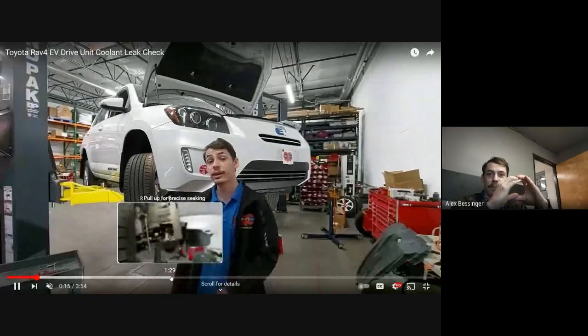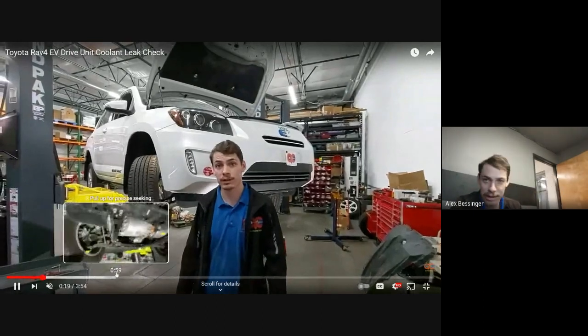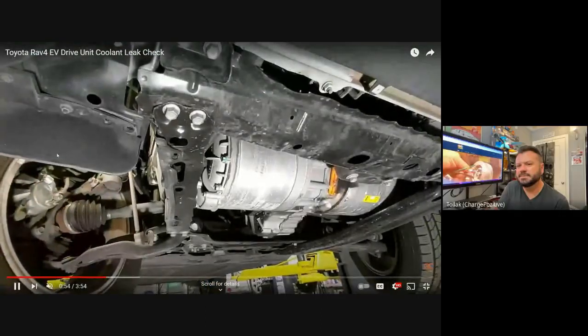It had those paddle chargers, right? It didn't have a J1772, but this funky paddle thing you'd have to stick in there to charge it. Pretty much all the 90s and early 2000s EVs had to use that paddle charger, right? Some cars didn't. I actually used to have two Ford Ranger EVs, and those used what they call an AVCON connector. It was J1772, but not with the connector that we know today. It's the same communication, so you can make an adapter that goes between the two that doesn't have to do any adaptation communication-wise. It's just the connector itself that is different. It's kind of a big rectangular thing that you push in and then turn and push down. They call it an AVCON connector.